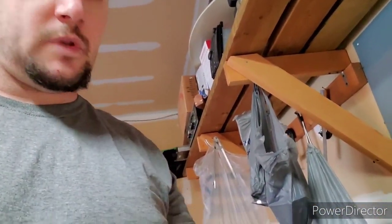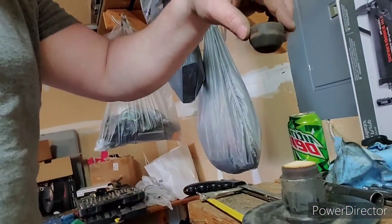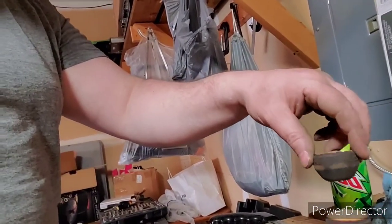So when you got that at the bottom of your spring, well, I got it in the spring, it don't want to come out, but basically you got the two pieces in the middle of the spring acting as the top of the spring, coming down every time your suspension's giving. That hits the top when you're bottoming out to make it a softer hit rather than a harder hit, because this is rubbery but it's pretty hard, so it'll give you a little bit of a softer hit. But that's all that's for, and you got to trim that down because you want your suspension to still function.